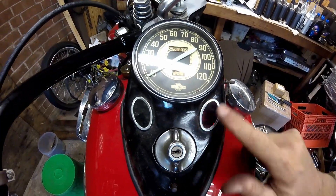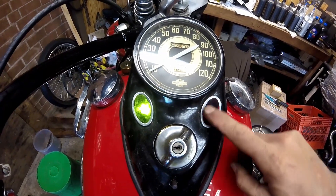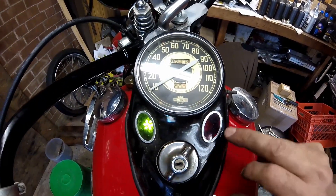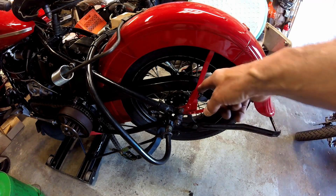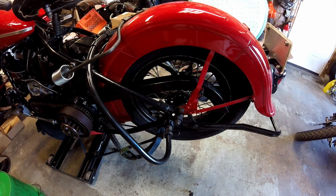Now I'm going to turn it on to see what the cat's eyes look like with the LEDs. Oh yeah, very nice — not a whole lot of bleed over. Looks real good, happy with that. This one is the generator charging light, and this one is the oil pressure. So that's it for getting the tanks on the bike, the fuel lines hooked up, and the dash on. Next video will be getting the back end straightened out — getting the brake on and all the linkages. First I've got to fit it up, then take it apart to move the rim on the sprocket a little bit, then put it back together for the final time. Thanks for watching — please like and subscribe and come back for the next video.